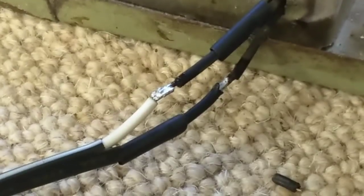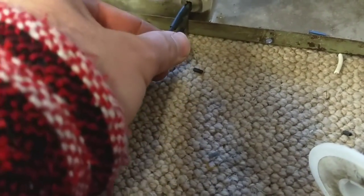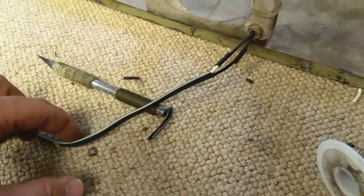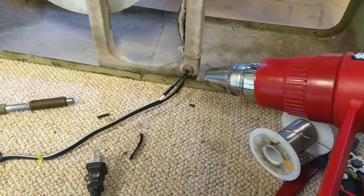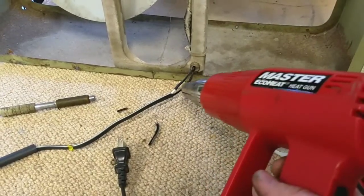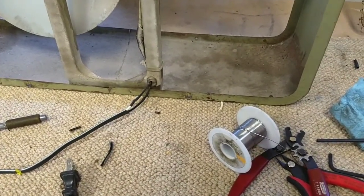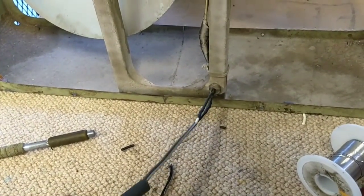So I'm going to do two layers of heat shrink - a piece of heat shrink on each one of these wires to cover that, and then a final larger piece that's going to cover the whole shebang right up to the strain relief. That will lessen the probability that there will be a failure of the cord that will result in a short circuit or a fire. So as you can see, I've got my wires soldered up together, staggered. We're just going to slip the heat shrink over them so that we're covering the splices, and I've got my bigger sleeve standing by here. Let's get the heat gun and put it all together. Then we'll get the larger of the two sleeves over top of that and shrink all that down.